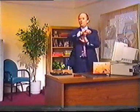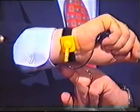Begin by removing the system unit case. This procedure is covered in section three of this video, so we won't repeat it here. If you feel it's necessary, review section three now. Be sure the computer is turned off and unplugged. It's also a good idea to wear the anti-static wrist strap or work on an anti-static mat. Static electricity can damage the chips you're installing or other chips on the motherboard.